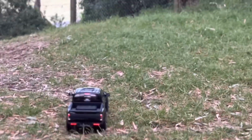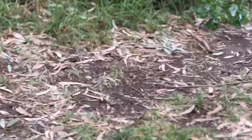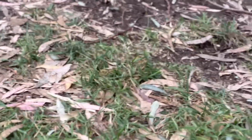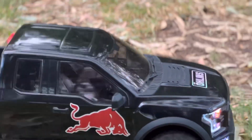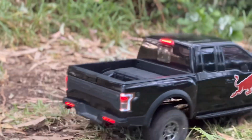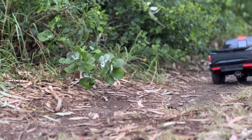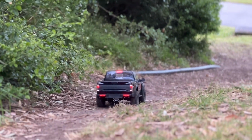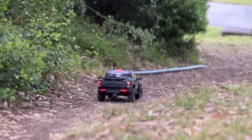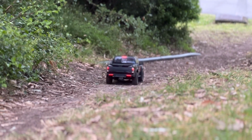But it's got a lot more speed. You see, this would be the top speed in high gear with the brushed motor. But now I was just literally touching the tip of the accelerator and it was going. Okay, so the next hill climb. Let's see in high gear, does it have enough resistance to stop? I put a bit of coasting. So in high gear, you can see that 75% drag brake isn't enough. I'm not pressing anything. Finally came to a stop over there.